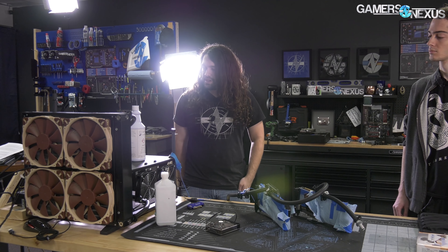That tube's been uncovered, but not for most of the time this bench has been sitting here. The top of the reservoir was uncovered for a bit. But any dust or debris that floated in — there's like a mile of tubes hooked up to this thing. The dust would have had to travel up without a pump through this complex pump body. So whatever happened, it happened in the video card block itself from stuff that was probably already in the water.